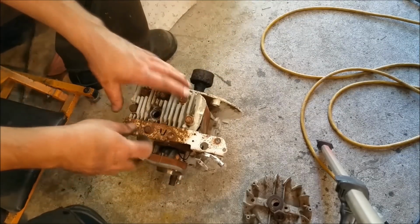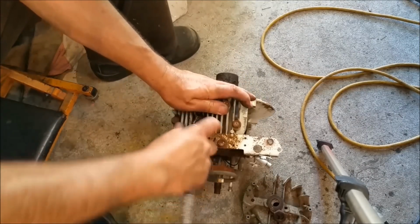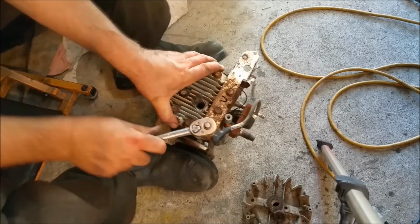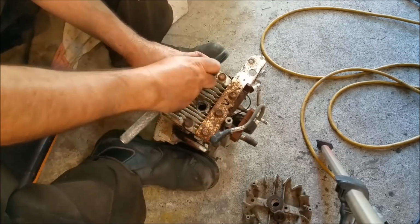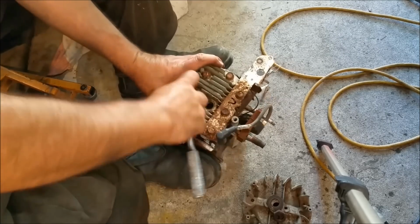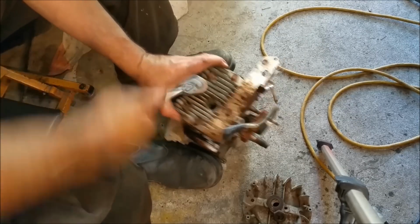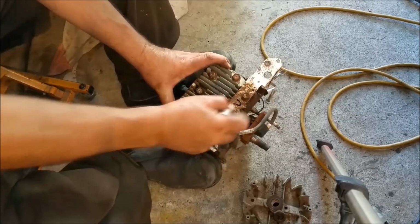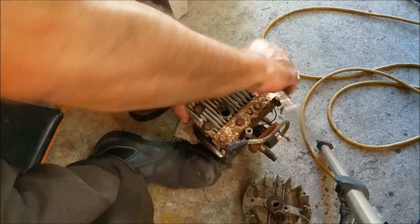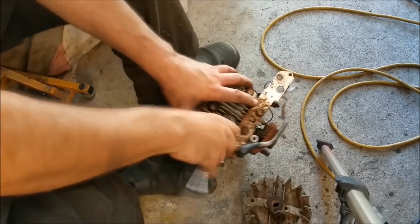I want to take the head off. Let's have a look and see. So we go around and we undo them. Actually, we'll do it in diagonals because that's what we're meant to do, in a circular motion. And I'm just burning with curiosity to see what a buck buys us in a Briggs. I'm not tipping it's going to buy us terribly much of any value at all. But you know what? We got a throttle cable out of it. We got wheels. Bloody hell. We got...